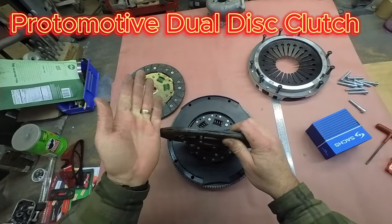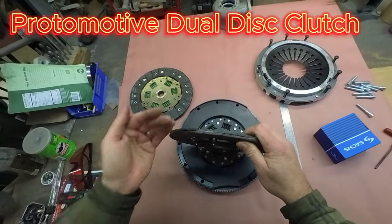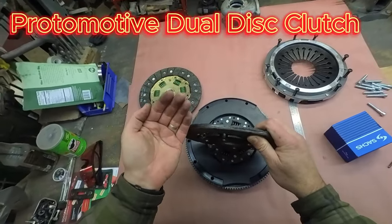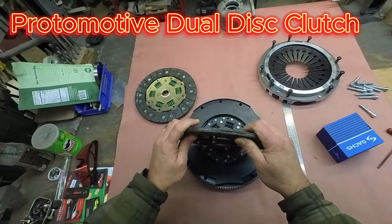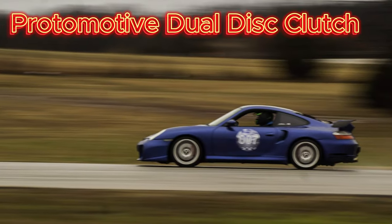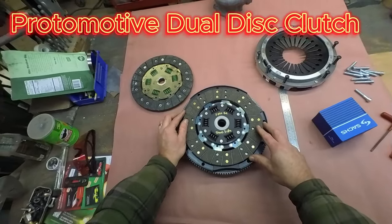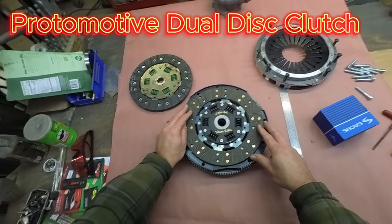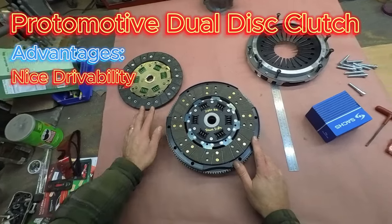where all the way down, fully disengaged, about 25%, you know, a little bit of ankle into it, you can start feeling the clutch, a little bit of drag starting to take off, and then you have a wide range of engagement from that 25 to 70%, then from 70 to full is fully engaged. And you're having a lot of fun. So versus a ridiculously hard to drive car with non-Marcel facings, we've combined both in this for nice drivability, just like factory.